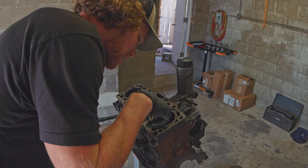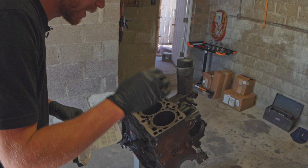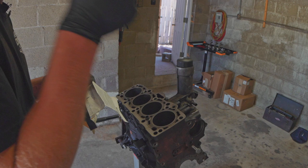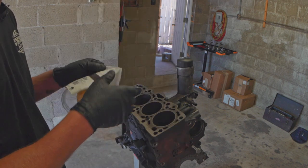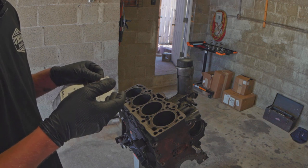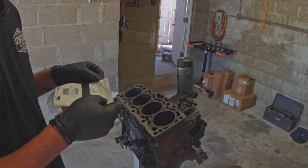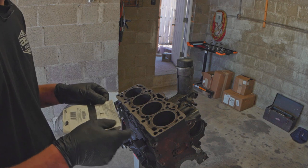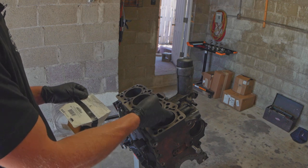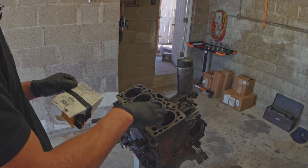This won't take long. I think there's a worn-in spot where the pistons actually traveled, and at the bottom not so much, so I want to clean up those discrepancies and make sure everything looks uniform and shiny. Then to finish off, you have to go quite a bit faster to hit your 45-degree angle crosshatch, and it says honing time should be approximately 20 to 45 seconds per cylinder. Wash with warm soapy water and a nylon or natural filament tube brush, and continue cleaning until a white rag comes out clean — that's very important. This whole process creates a lot of micro grit — partially from the hone, partially metal from the walls — and it's super important to clean that off afterwards.